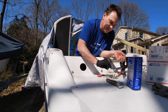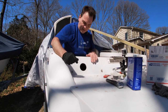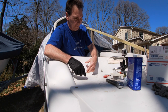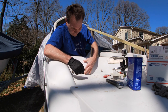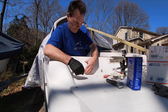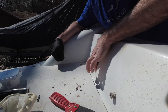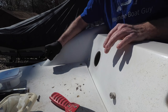That's pretty much perfection right there. Alright, so we got our surface all prepped. Got our new one right here — it goes in like this. And as you can see it moves around a lot, so I'm going to build a lot of caulk up on the top edge here. And on the bottom edge because of the fact that this panel is curved and this is flat. But that's the original thing that was installed here — exact same brand.